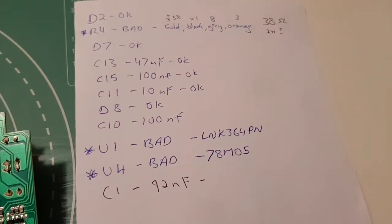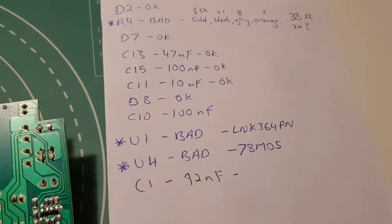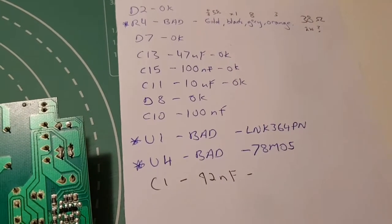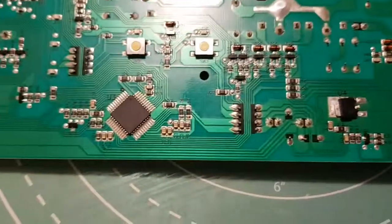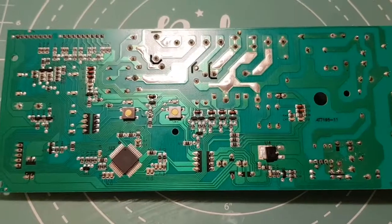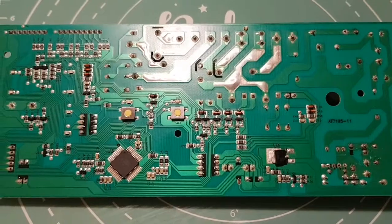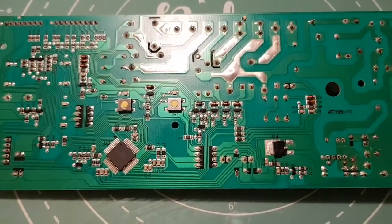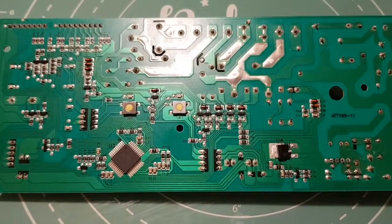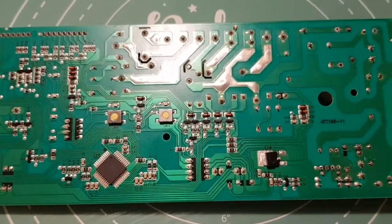I've already gone through all the other components and made notes. I looked at the diodes around those faulty circuit components and did some tests with a multimeter, checked that the capacitors are within range, and all the diodes are working. So I've got those parts on order. Worst case you can still buy these boards — there are a few websites in the UK where you can put in the model number and get the required part for about £60. But the three components I'm replacing probably come to a few pounds, so I'll try that first.